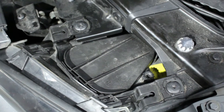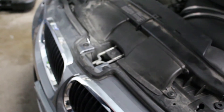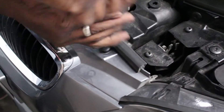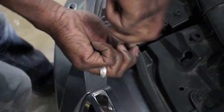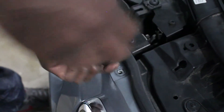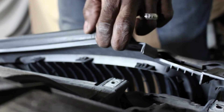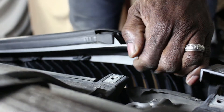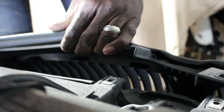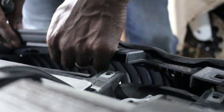Now we're going to take out these four Torx screws with my Torx screwdriver. I'll put these out of the way so I don't lose them, then start removing the grille. We're just going to pull back on the bumper and you can see the clips right there — six clips: one, two, three, and the same at the bottom. We're going to pop them out. This is where your flat screwdriver comes in handy to squeeze the tab down. The top is loose; now we just have to do the bottom.